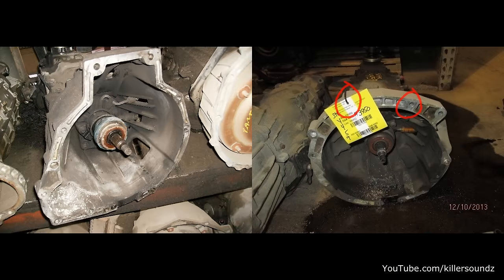Here's a diagram I put together — the left one is the older-style Ranger manual transmission, and the right one is the post-2004/2005 style that I have in my 2008. The two circled bolts are the hard ones to get to. The left circle isn't that bad — you can get your arm up there from the passenger side. But the right one you have to go in through the driver's side wheel well past where the starter mounts, arm way up in there, using the ratcheting combination wrench. That's the bolt I didn't put back in.